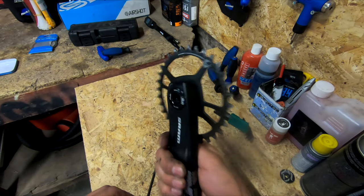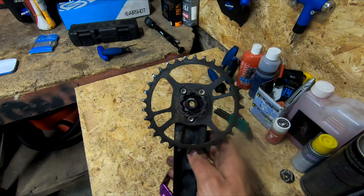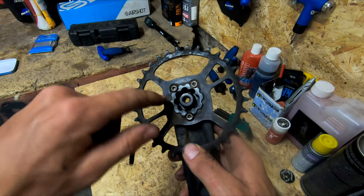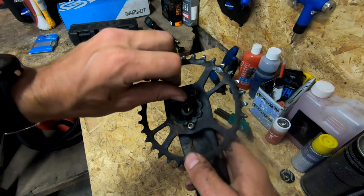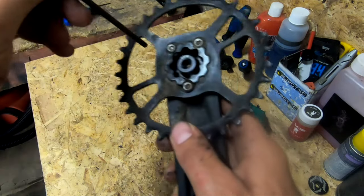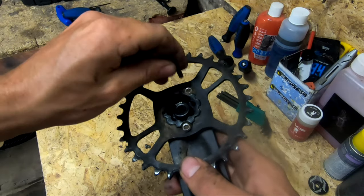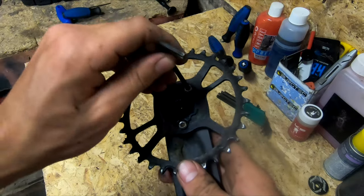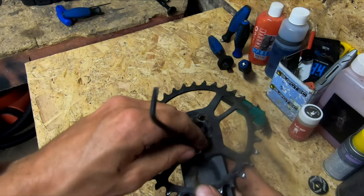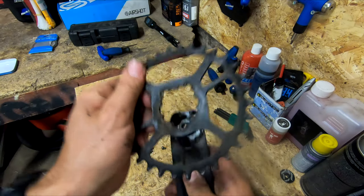We are ready to take the chainring off. There's the front, there's the back - you've got three bolts here which take a T25, which is like a little star allen key. Just make sure the allen key can locate into the bolts correctly because there could be some dirt inside there, so just pick out any dirt to make sure you can get in there and don't round them off. Give them a turn to make sure they're all loosened off initially, and then undo them. Don't lose these bolts - you may need them for your new chainring. They can be a little bit tight sometimes and might have seized, so just be patient. If you struggle, take it to your nearest bike shop, and it should just lift off like so.